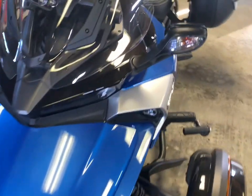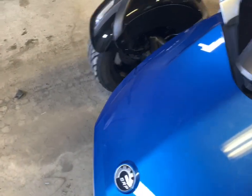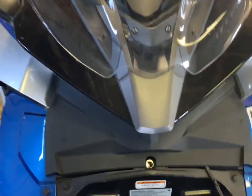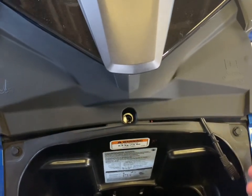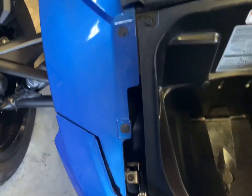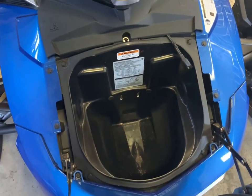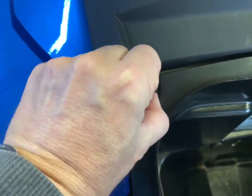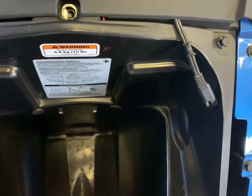The first thing we're going to do is unlock the glove compartments and take out the liner. K&M liners come out pretty easy. They basically have plastic rivets — you just pop them out. You can use a screwdriver to slide right under there and it pops right out: one, two, three, and four. Then we'll slide out the liner. I popped all the rivets and they just pull right out.